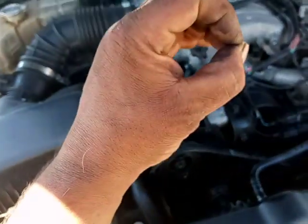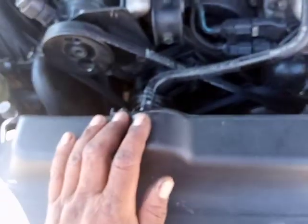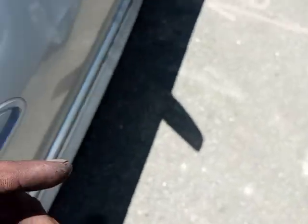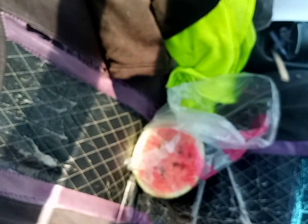For the technician who touched this car, I give you a donut, because I can already tell you messed up on timing. But anyway, I'm going to end the video right here. I have to charge it because I'm running out of battery, but I'm going to set timing to TDC and we're going to double check this. But this is again a 2004 Kia Sorento with P0301, 300, 301, 303, and 305. Okay, so when you get these codes, mind you, the whole bank failed, so just double check yourself. Don't be too quick.